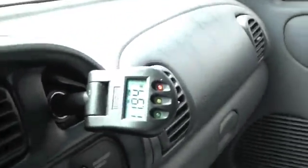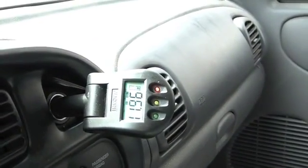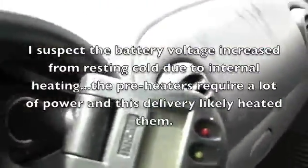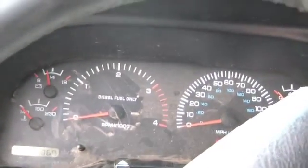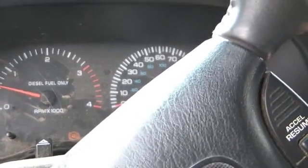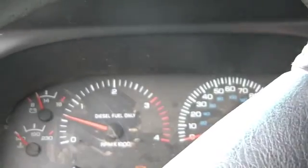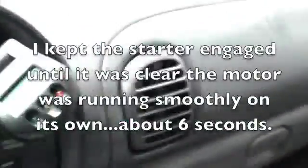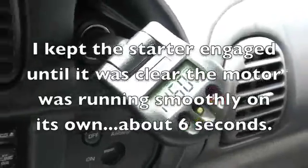You can see here that our batteries are at about 12 volts. So I'm going to hop in and try to start it and see how she does. The wait-to-start light is out. You can see now that the battery voltage has gone down to about 12. We'll turn it over. So that worked — 11.4. Obviously it was a little slow in starting.